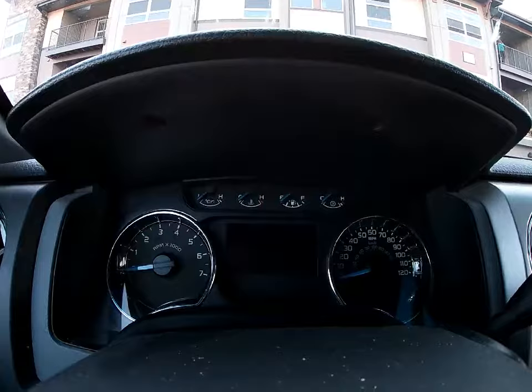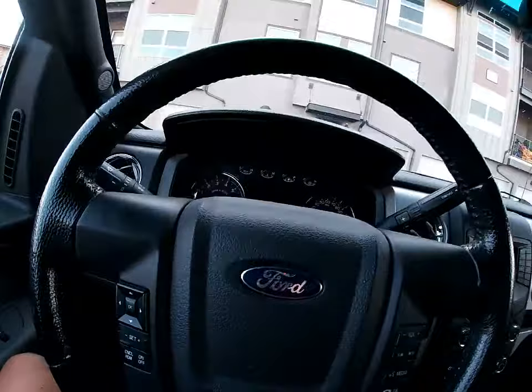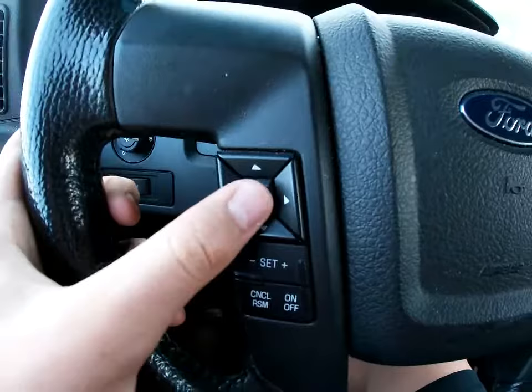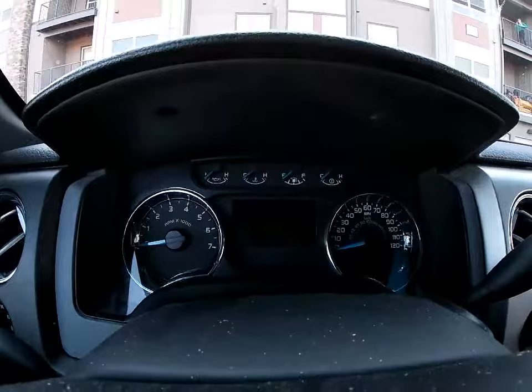And it is in simple steps. You have to start off with the key — right here is the key to this truck. You need to turn on the vehicle, but before you turn on the vehicle, you need to locate this OK button right here. Basically, what you do is you hold the OK button for two seconds, put your foot on the brake, and while you still have your finger over the OK, you turn the truck on, and it will go through a little system in this middle part right there.